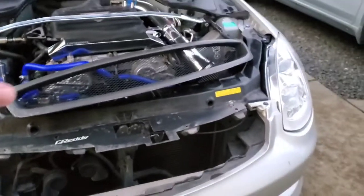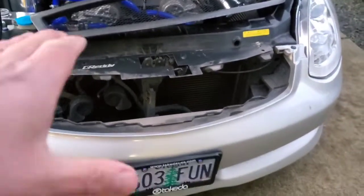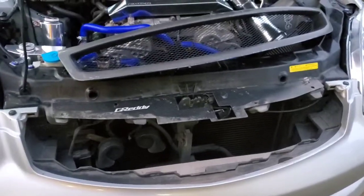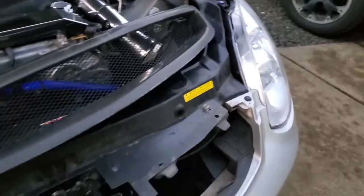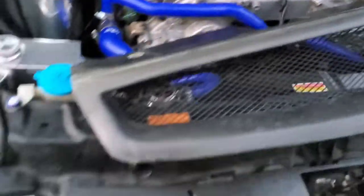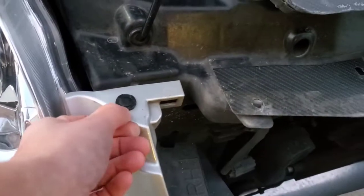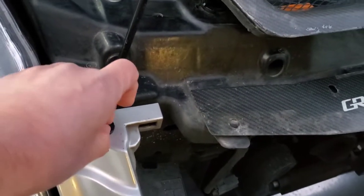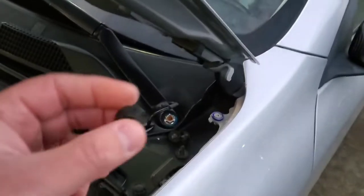I'll use this time, too, before we put the grille back on — I'm going to get that cleaned back up underneath there. This is what it's going to look like on the front of your car once you pull your grille off. If you're unsure how to do it, it's just going to be the clips across the front — there's four of them. Take a flathead very carefully, place it underneath, and slightly pry up, and then you can pull the clip out. You'll end up with something like that right there.